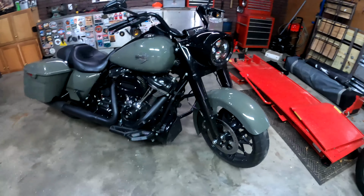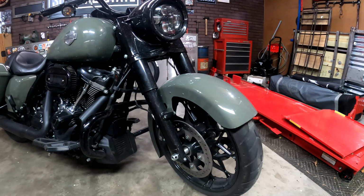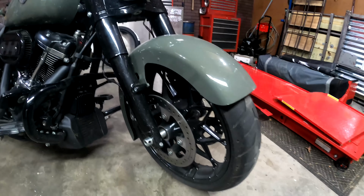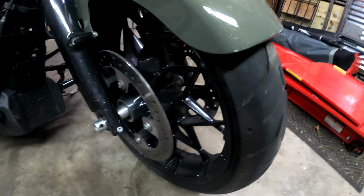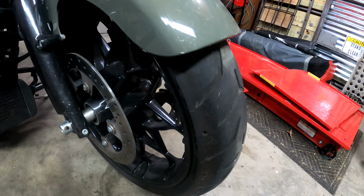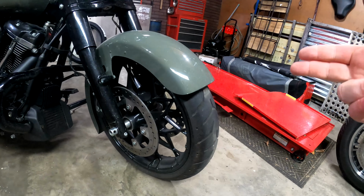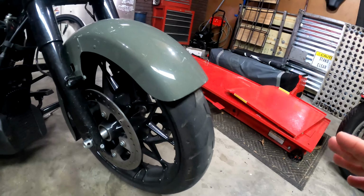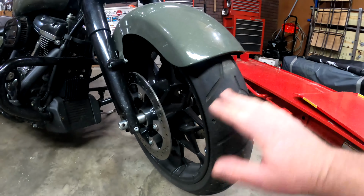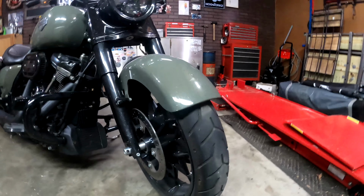All right, first things first, let's go ahead and take a knee here. First thing to cover on T-CLOCS is the letter T, and that's tires, wheels and tires to be exact. So the first thing you're going to do is come on over here, get a close look at that tread. This tread is actually pretty good. You got some gauges you can buy to check that out and double check, but checking with my good old eye here, tread is pretty good. Okay, next thing you want to look for is make sure there's no punctures or anything in that tire, so you don't have any leaks while you're out on the road.